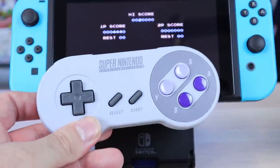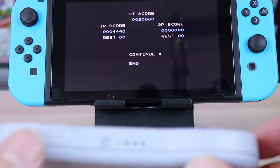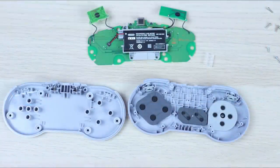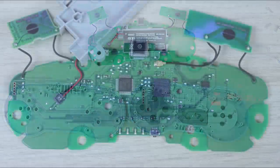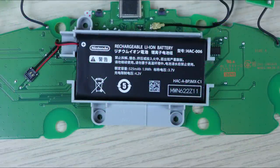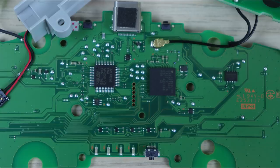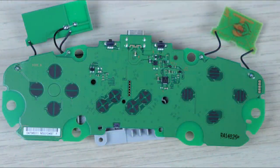Let's go ahead and tear this down. I'm going to show some images and some close-up stuff. There are a lot of little parts in this thing — light pipes for the little lights to indicate player one or that it's powered on, and the power light on top. The ZL and ZR buttons require springs and are situated in there a little weird. There's a nice battery in there — I believe it's about a 480 milliamp-hour battery — and that comes off the main board with three screws in a little housing.